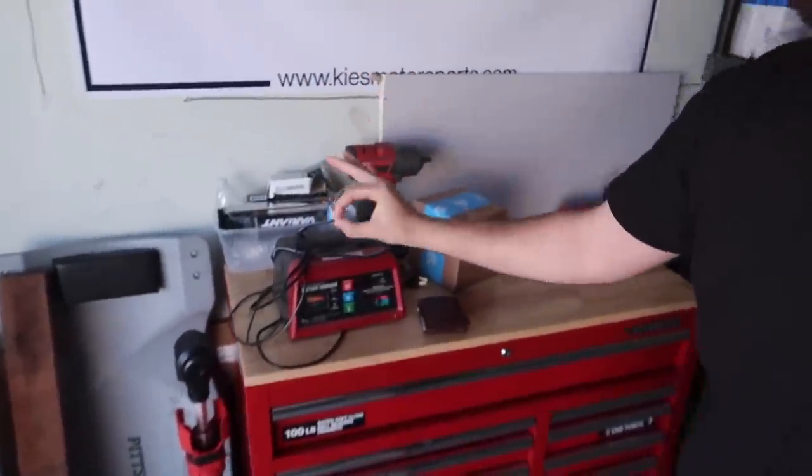We will need to jump it though — it has absolutely zero power. Maybe a bad battery could be the issue causing it not to start. It is a V10 and probably has a lot of electronics, so like the 7 Series, a bad battery might mean it can't crank. The goal for today is just getting the M5 started. My biggest fears are needing a new clutch or the engine being bad, so fingers crossed it's just the sensor or the battery.